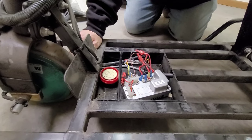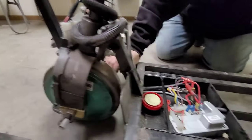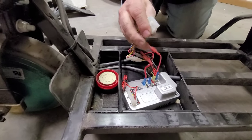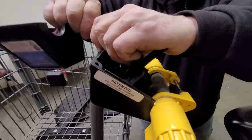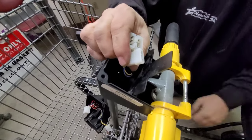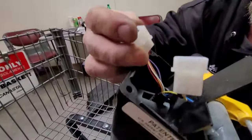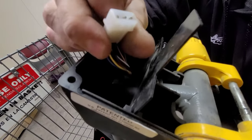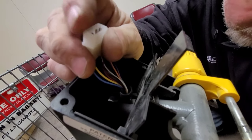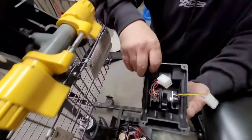To test the motor, you run a direct line from your battery back to your motor leads. For the continuity test, pull off your 18-pin or 8-pin connector, come up to your pot assembly, pull those plugs, and do the same audible continuity test — a little bit easier but still a balancing act. You'll see the yellow wire; come over here, find the yellow on this end — looks like the second one over and the one in the middle. Hit that yellow wire and you'll get an audible. That's how you test the wiring harness — no different than the Value Shopper, just slightly simpler.